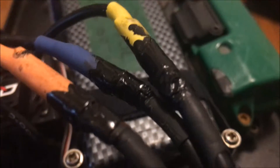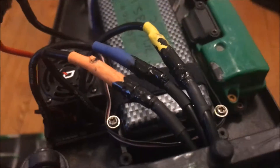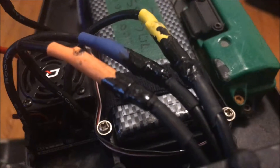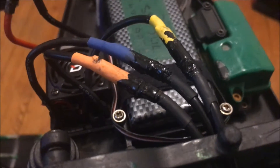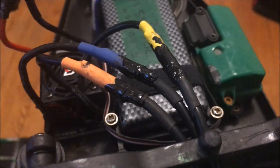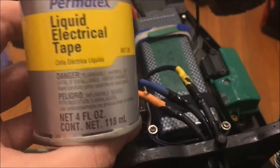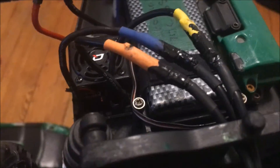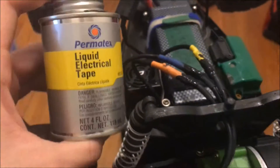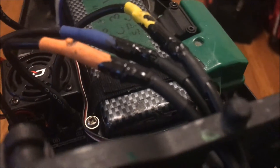The connectors are done, everything is nice and there's a strong connection. The copper wire keeps them nice and tight. I put some liquid electrical tape over the connections so they can be a little more secure and won't come undone while I'm riding off-road. This is what I use — liquid electrical tape — it's just like a paint really and then it gets harder. So it's pretty nice, and that's it — hope this helped a little bit. Here is the new motor.